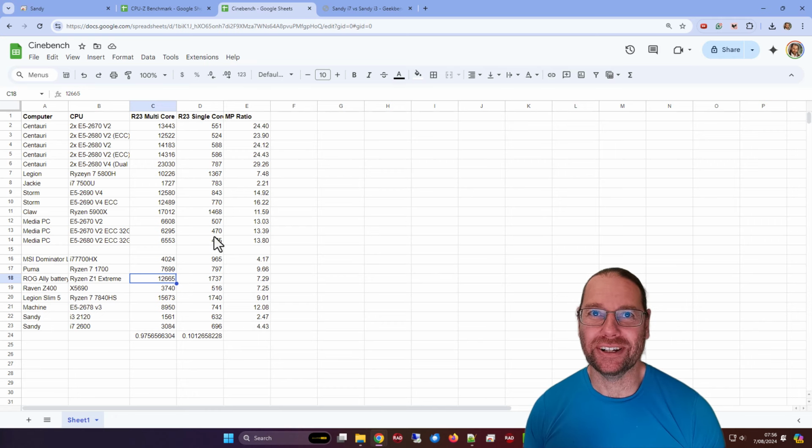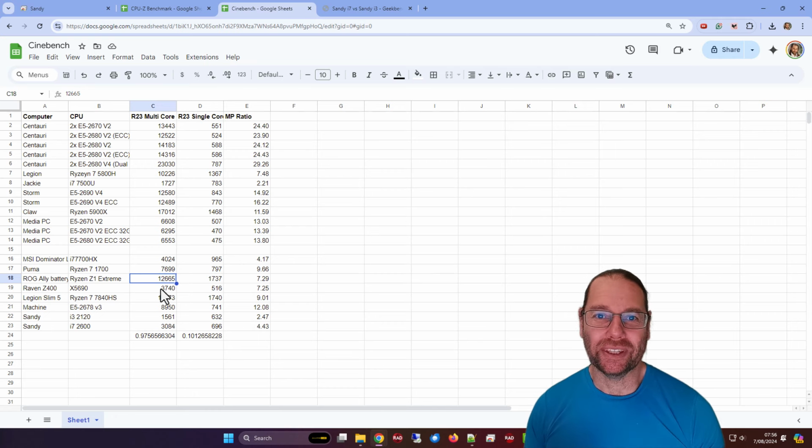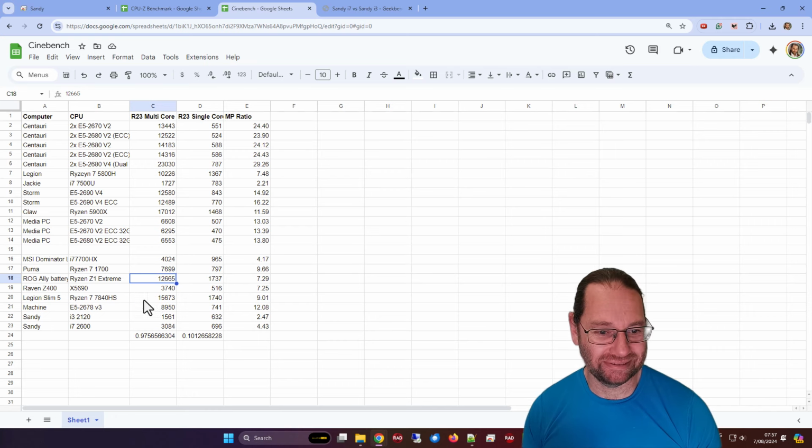Definitely, if you've got old machines, you can upgrade them with newer CPUs quite inexpensively. Generally speaking, the most powerful CPU in a given version, so the second generation i7, this is not the fastest one, but it's a lot faster than the i3. And usually the fastest one is quite expensive, but usually if you go down a couple of tiers, they're quite cheap. And usually there's only 10-20% difference in performance between the top i7 and the mid-range one, or the next one down.